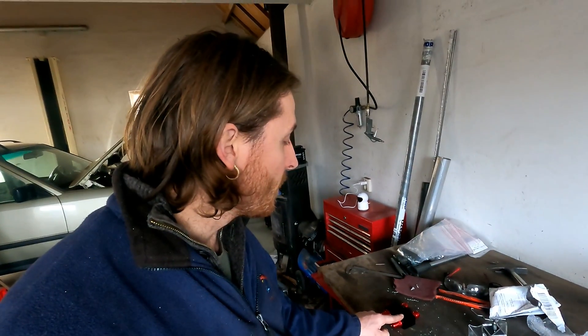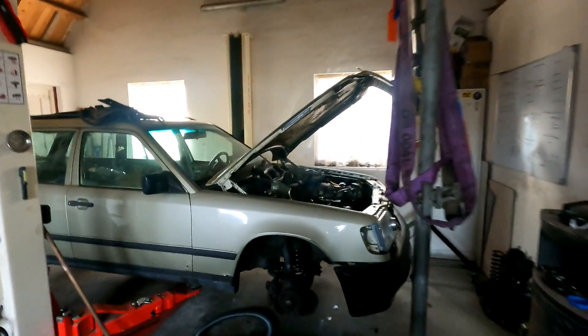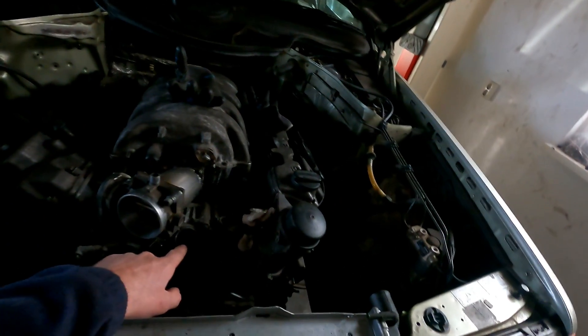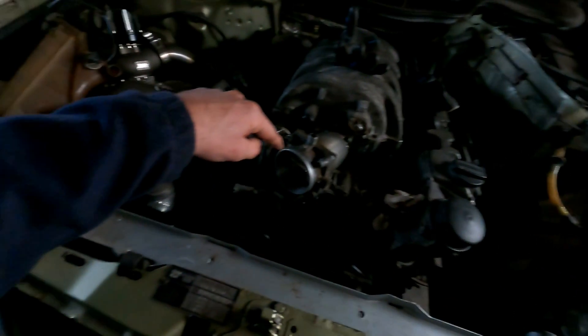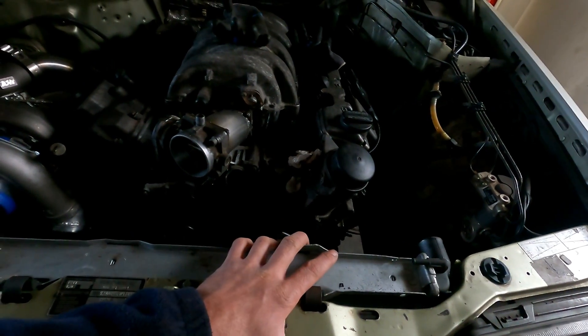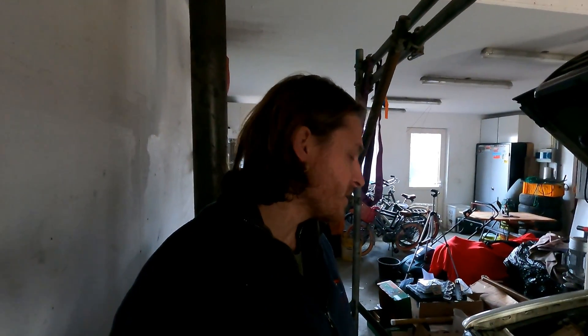I have to figure out where to place this one of course, but it will be AN10 lines to it. I also have to find the best routing around the cooling water piping, because there needs to be a hose here, with a bracket on here with two hoses. So first I'm going to cut the piece on the router so it's nice and tidy, then make the holes, put the adapters on it, and go from there.